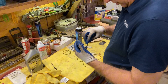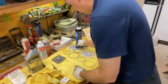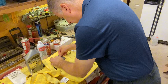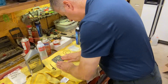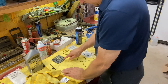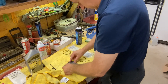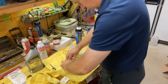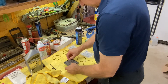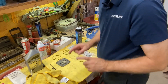Get those o-rings in here. We'll inspect this really closely and we'll get ready to clean the pump, then we'll put these back in. So now we'll take our new o-rings and put them right in place. The way I'm looking at this now, we may have to bring this pump over here and disconnect those lines, because I'm not sure these are gonna stay in place when we put it together. I think we may have some difficulty with these staying in place — see, they're already falling off. So I think what we're gonna do next is go ahead and take that pump off and bring it over to the bench.